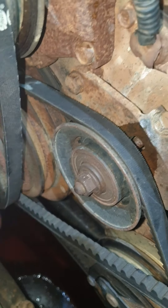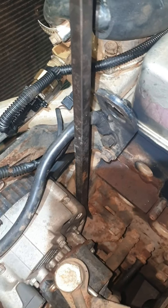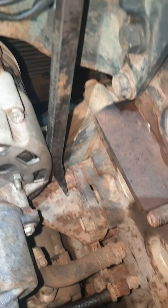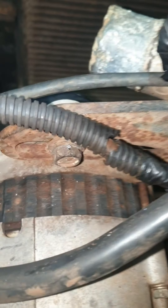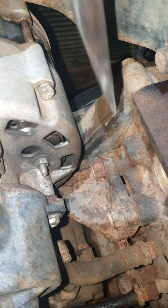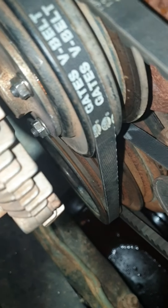Lock the power steering assembly up. Give them a little mark if you want so you can remember that you've done them, especially before a trip. For the alternator, I've put my pry bar between the bottom mount of the alternator and the housing, pulled it back till the belt went firm enough, then tightened the bolt up. The bottom bolt you want firm but not over tight, so you can adjust it on the side of the road.